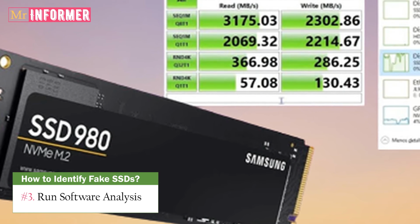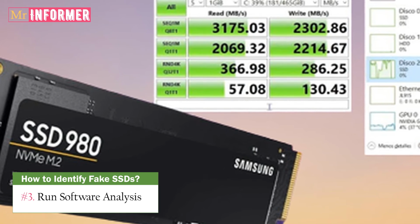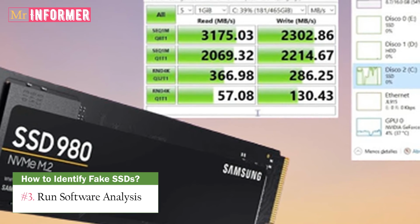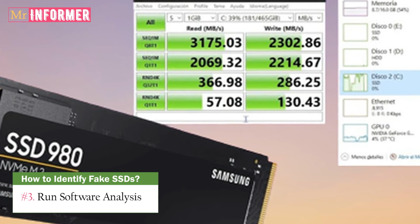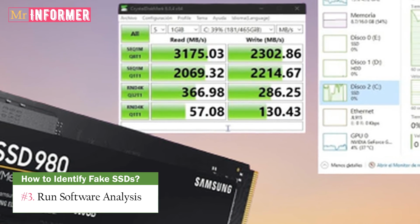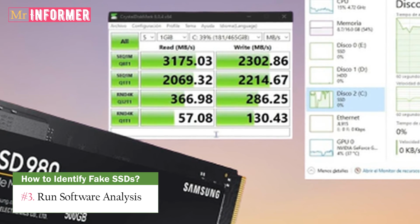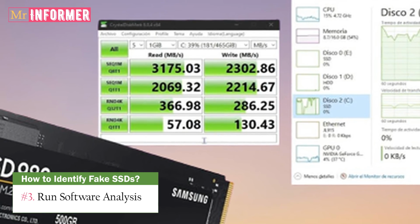Attempting to run a few apps or games on the SSD you're evaluating is another option. Reduced speed and longer loading times in games will almost immediately reveal the fake drive. You may also verify whether the drive really has the capacity it claims by loading a few large games onto it. As previously stated, when old data approaches its storage limitations, smaller drives that are configured to appear with larger capacity when connected to a computer replace old data.